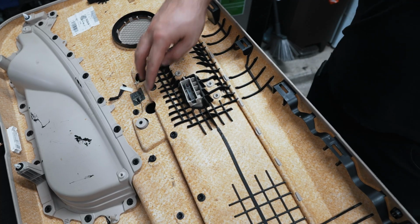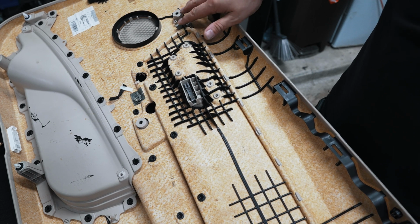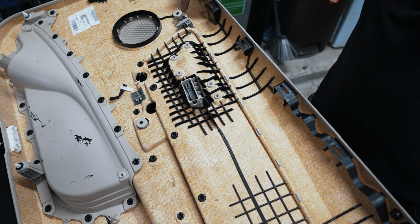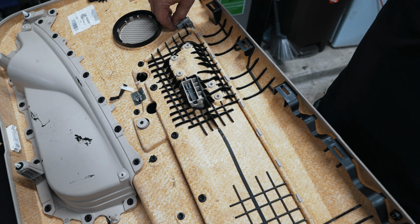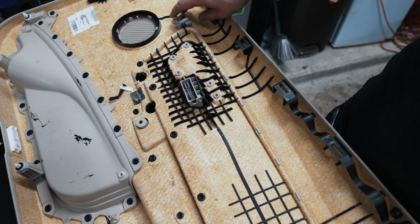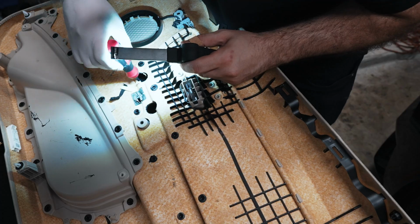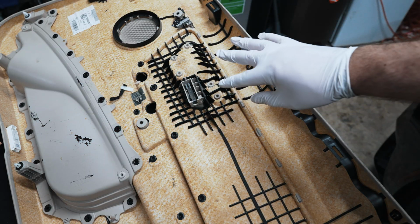So some of the aftermarket options are going to allow for you to screw into here, but like I said, it's the color that's the issue here. I have the oyster color, so I had to go OEM. You're supposed to melt these. I'm going to do the same thing I did on my E90 where I put some 5-minute JB weld around here to set and hold. It's been holding perfectly for getting on, what, 6 years now. So I'll let that go off and then I'll come back and get the other door panel off.